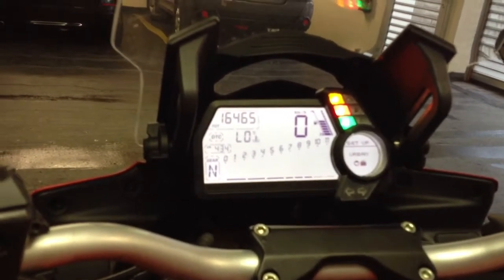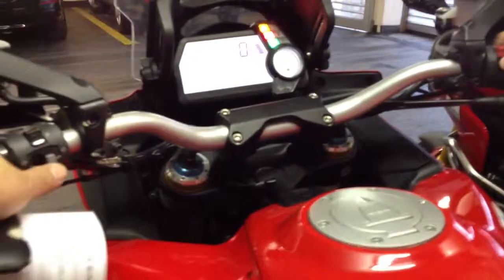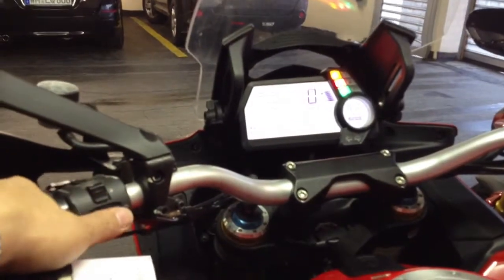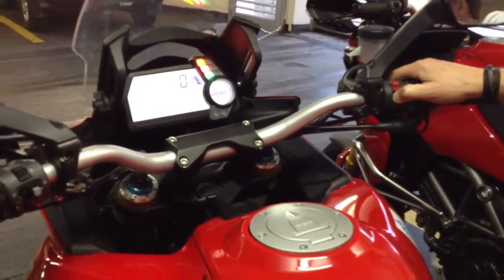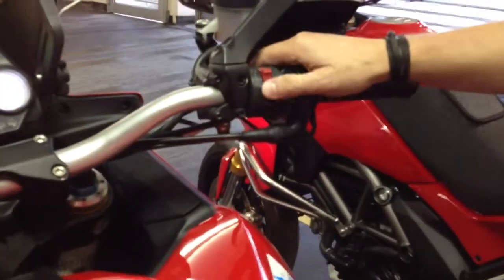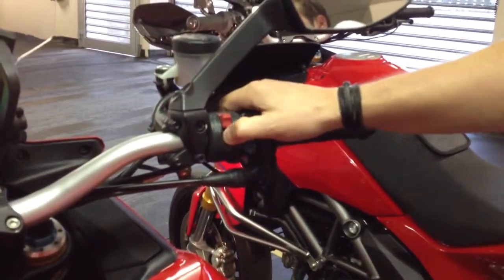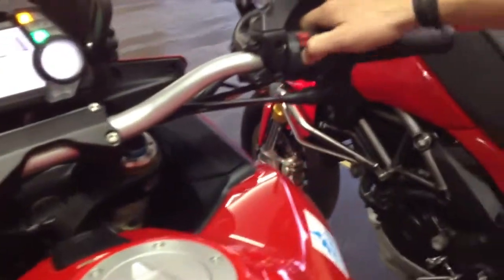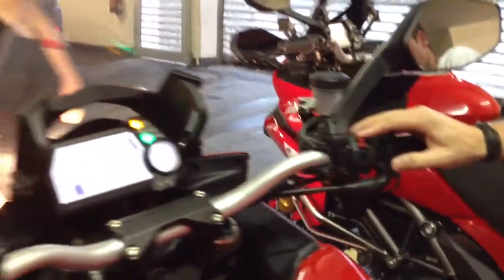You will feel the change directly. Also very important — about the question that's always asked, probably when there's rain: the heated grips. Heated grips is easy — the engine has to be running. Then press that grey button for three seconds, the same one you use to start the engine. Then you can change the level with that. Leave it and it's on max. Press again and leave it and it turns off automatically.